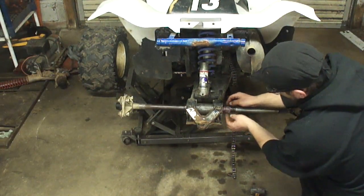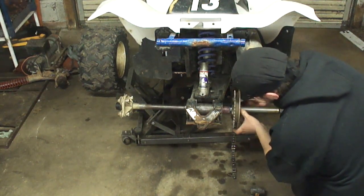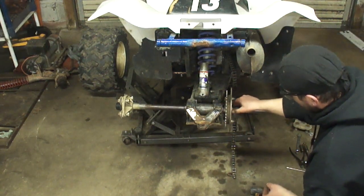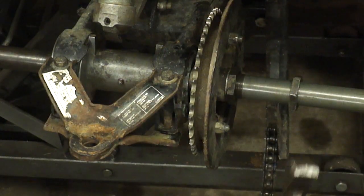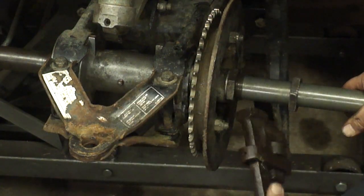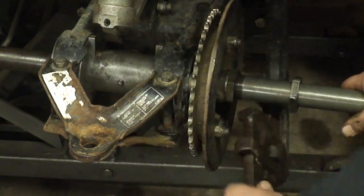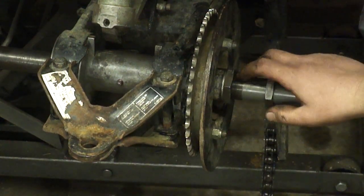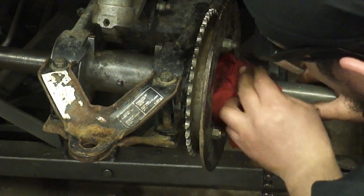Don't forget your O-ring that goes on next. Now you can put your sprocket hub on. There's also an O-ring that goes against the sprocket hub, in between the sprocket hub and the bearing on this side. Then the flat washer goes on against the sprocket hub, and then put your two nuts on. This nut gets torqued to 150 foot-pounds. I'm going to clean the threads with brake clean and then use some blue Loctite on the outer nut — you've got to clean the grease off because if there's any grease the Loctite won't work.